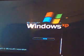And now I think what you could probably do is set it to, once it's finished with the copying of the text mode, again I'm going to choose the second option down so you can see that, GUI mode setup XP, just going to press enter then. So what you could probably do is after it's done the text mode and copied all the stuff across, ready to go into the GUI mode, you could probably switch the boot menu around. The boot priority, you saw me do at the beginning with the BIOS.